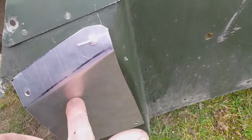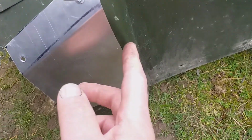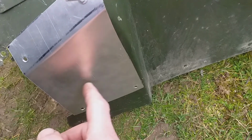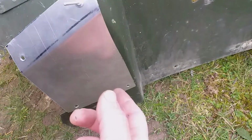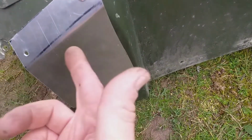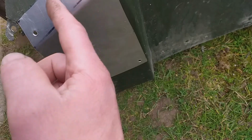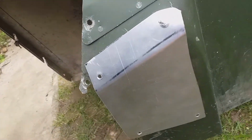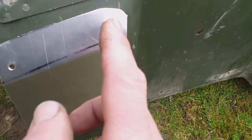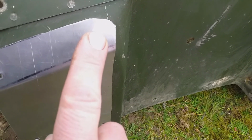So there is a part number for this. It's a petrol only part number for the Series 2A, and what it does is it blanks over the cutout in the wing for the diesel exhaust pipe, and it's not available easily anymore, so I've just fabricated a piece out of aluminium. It's roughly the same shape, and I've drilled the holes which correspond to the holes already in the wing. You might be able to see one round there. When I'm fitting something like this, I've found that with this pop rivet, I've given it a couple of clicks. It's not gone all the way, it's not popped.